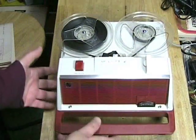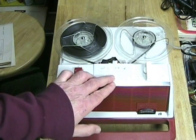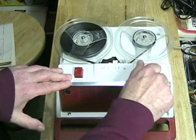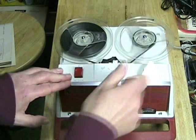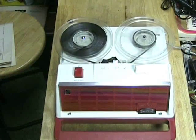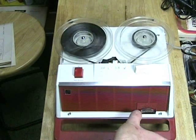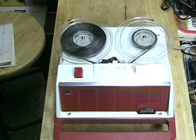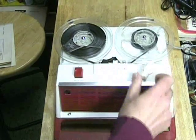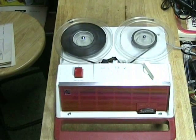Let's take a look at some of the functions in operation. This is a gravity-feed machine, which means it depends on gravity to work — it only operates in the horizontal position. Going into fast forward, you can see playback, pause, and fast forward. It takes a while to come up to speed because it is driven entirely by the take-up clutch mechanism — it is not a separate drive system, which we'll see when we look inside the machine. Then we go back into play, stop, and then rewind, which is a very high-speed rewind.